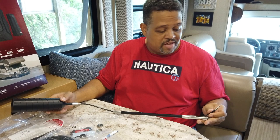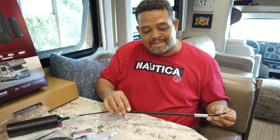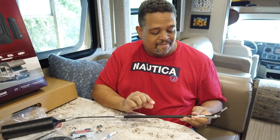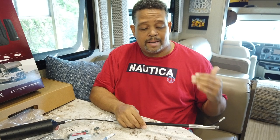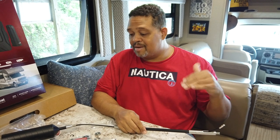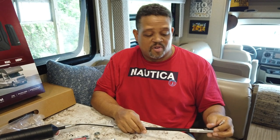While sitting at the kitchen table before going up on the roof, I wanted to do a little assembly. I know I want the extension piece on the antenna — I'm going to attach this to the ladder and make sure the antenna is above the AC unit, while making sure it's not too tall for height restrictions. It's usually about 13.6 feet on the east coast and 14 feet on the west coast for maximum height. Our rig is at about 11 and a half feet to the top of the AC unit, so I'll make sure we don't exceed that, but I definitely want to extend the antenna as far as possible.